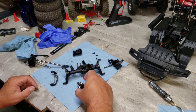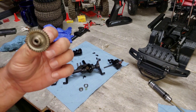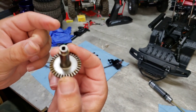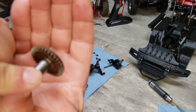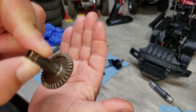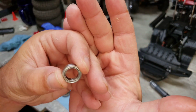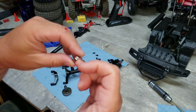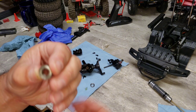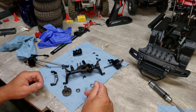This is what your spool looks like in the HB Toys — just a solid spool mount. This is what the gears look like on it; pretty nicely cut gears. And here are the bearings: they appear to be decent quality, smooth with no grinding. They are metal-shielded bearings — so they do have the metal shield. That's your front diff.